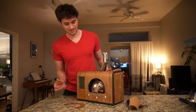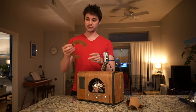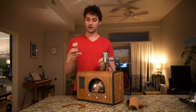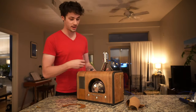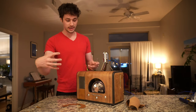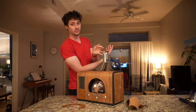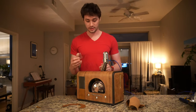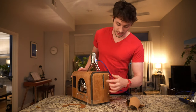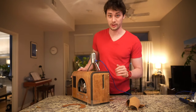In my totally not biased opinion this is coming along great — I'm super happy with this thing. Three more things to do: one, a little leather shroud going around the fan to make it look better integrated; two, a plastic piece glued to the lower part of the fan to guide air pulled in up to the heat sinks so it doesn't just go around the motherboard and miss them; and three, the I/O cutout is rough so I'll sand and paint it to look a little better.